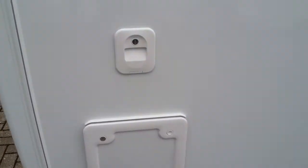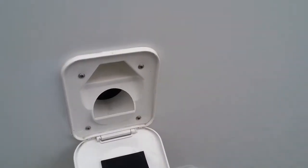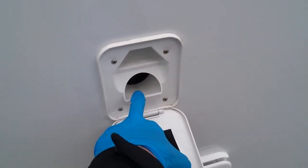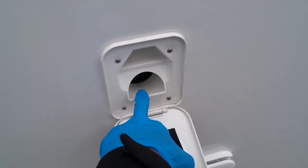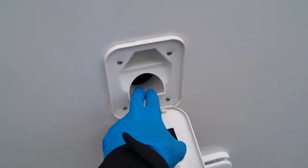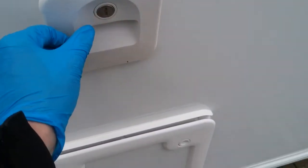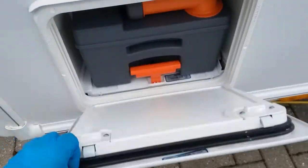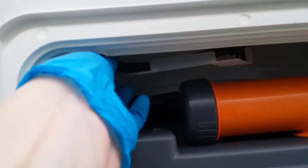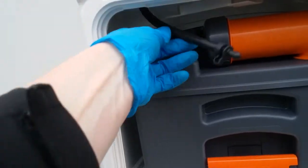The toilet is here. At the top is the header tank fill for the flush water — you can pop your pink solution in here if you wish and then top the rest up with water using a hosepipe or a watering can. Never travel with this completely full as it will slosh around and make a mess inside. If this needs draining down, just come to where the cassette is located and tucked up here is the drain tube for it.